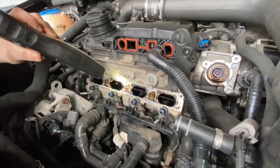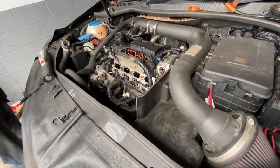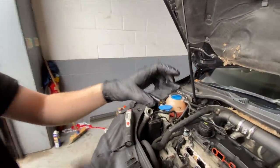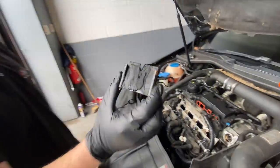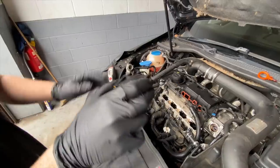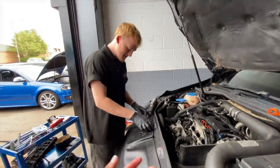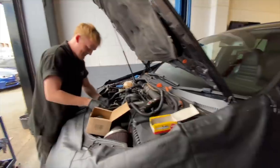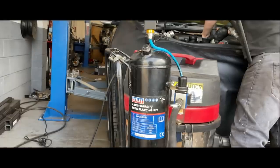Yeah, they're quite built up. Still enough on there, isn't there? The filter baskets don't get annihilated, so that's a good sign. So we're going to get a clean set of these as well. Sweet. Which Corey's doing next door at the minute. Right. But they're quite thick, to be fair. They are, actually. It's a lot of restriction there. Probably why it runs a bit strange. It's weird when you're driving it, you could never tell there's anything wrong with the car. So, I suppose they're just really sensitive. All sorts going on with the Edition 30 today. All sorts.